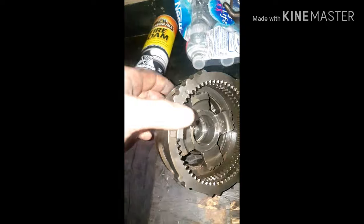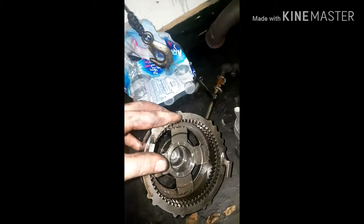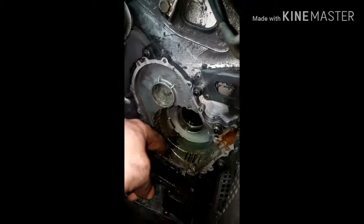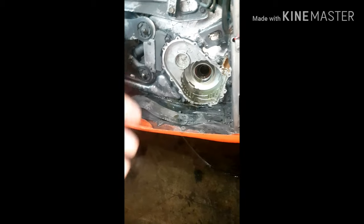It clicks in and out. To remove this piece here — this piece is a piece of cake, you just pull this out, it just sits inside of here. Once you get this rod out, this pulls right out. For this piece here, what you have to do is get a long extension — this is your brake side, there's a bolt way down deep inside that hole. It's a 5/8 socket. Long extension, pull that bolt — it's going to take a little bit of effort to get that out. What I did, I used a bar right here and just pulled top-bottom, top-bottom, and worked it out that way. Pulled the complete thing out.